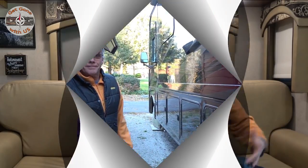Done. Done. All right, that's how Cheryl and I winterize an RV. We've been doing it since 2005. We're not saying that we do it the right way. We're not saying we do it the wrong way, but we haven't had a problem since 2005. Knock on wood. Well, fake wood. The main thing is you want to get the water out of all of the lines. Any place where there's water in the RV, it can freeze. So just get it out. Protect your lines. That's what it basically comes down to.